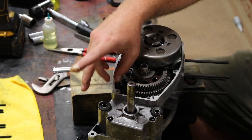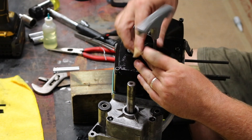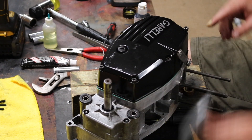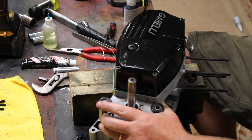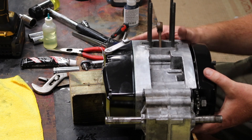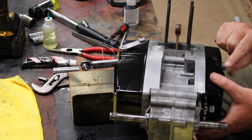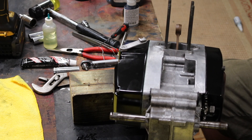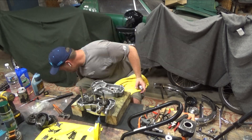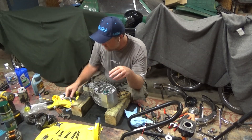Alright, we're in the home stretch — just putting some Honda Bond on for the transmission gasket, sticking it on and torquing it down at seven foot-pounds again with loctite. Lastly I'll install the ignition cover — this is just for looks at this point since I haven't actually installed the ignition yet; that'll be coming in a later episode. This is a bottom-end-only rebuild at this point. I've got big plans for the top end that you'll see in the next episode. As always, thanks for watching — see you in a bit.